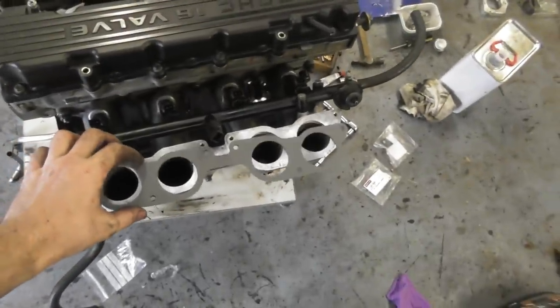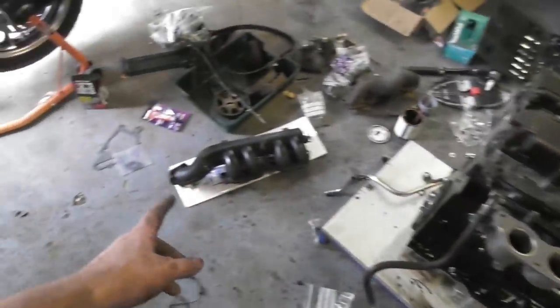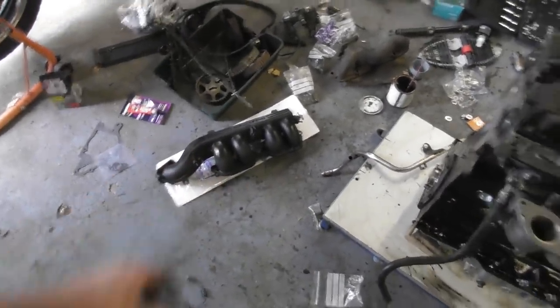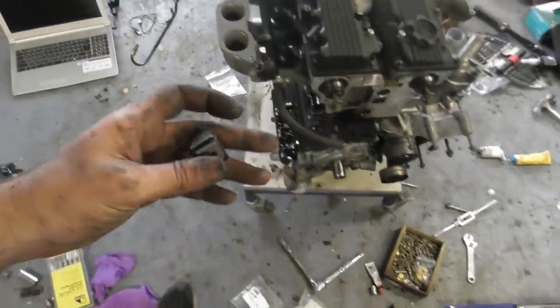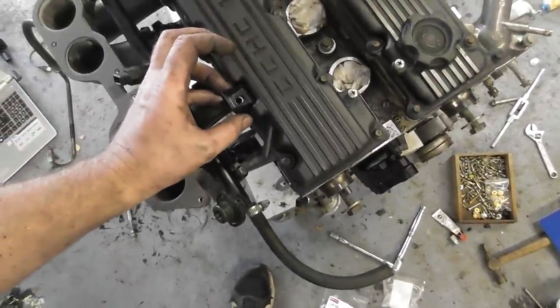Got a new gasket for the inlet — put all that back on. It's probably overkill, but I would have been annoyed with myself had that leaked and I'd not done anything about it. So the top part of the plenum is painted satin but still wet, so that needs to dry off a little bit before I mount it on there. The cam cover also acts as a top mount for that, and I was missing the little brackets, so I bought those — they weren't expensive. This car is going to owe me a lot of money, even though I was actually given it for free by Mike at NPR, which is pretty cool of him. Then you've got a little short M6 bolt on there and another one into the top of the plenum.